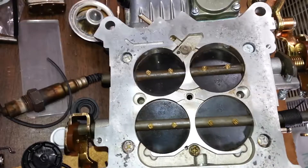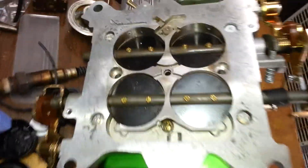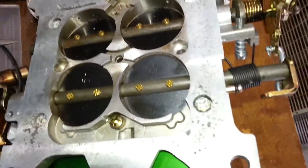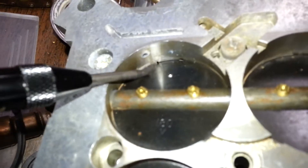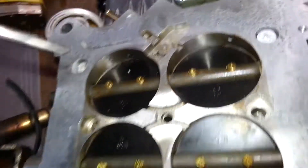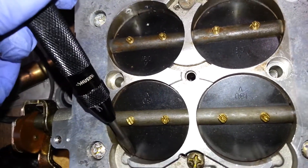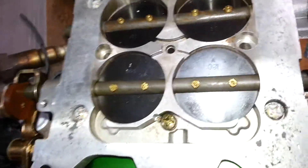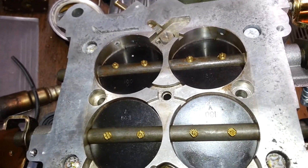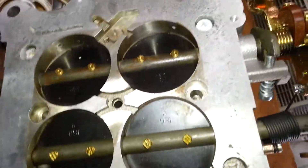What I've got right now is the transition slots on here — inside here — they're squared off. That little tab on both the front and the back. In the back I can barely see it, it's right there. We're still having idle problems with this radical cam, so Quick Fuel recommended drilling these holes. We're going to start with a sixteenth inch.